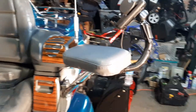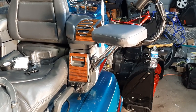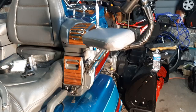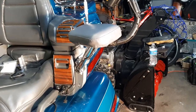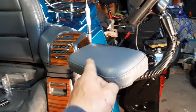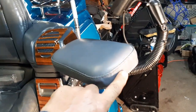I ordered a couple of ATV seat heater elements because they're smaller than car seat elements, and they're easier to trim down to the size you need, which is about 5 or 6 inches by 7 inches long. The heating element wraps up the side, across the top, down the other side, and over the nose of the pad.